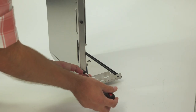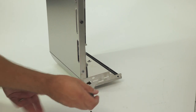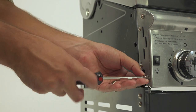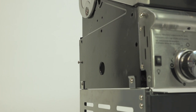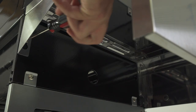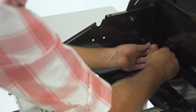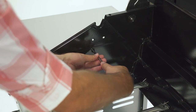Now it's time to mount your grill's side shelf. First, remove the three preassembled screws in your side shelf. Then remove the preassembled screw on the bottom left corner of the control panel and slightly loosen the other two preassembled screws on the left side of your grill. After that, slide the shelf into place, then retighten the two screws you loosened. From the inside of your grill's firebox, use three A screws and three C washers to further secure the side shelf.